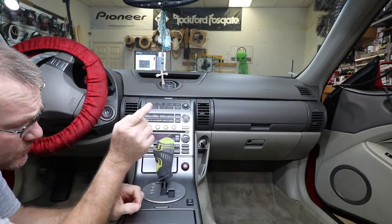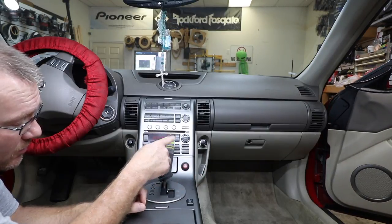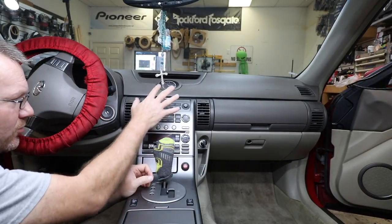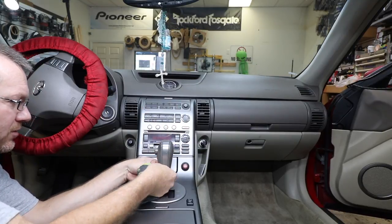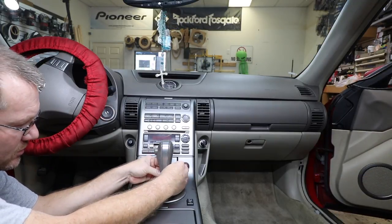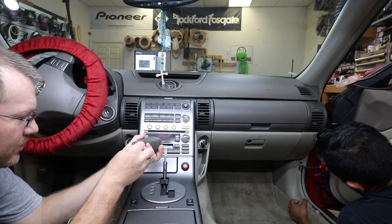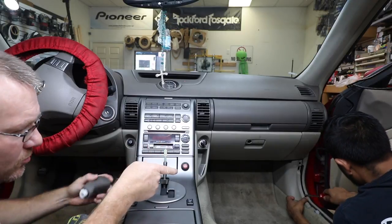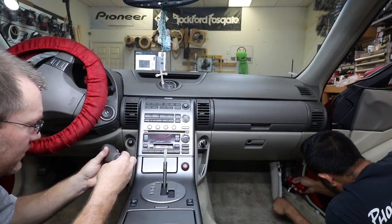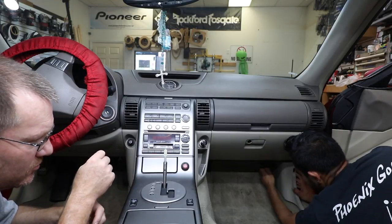To replace the radio, you actually have to start over in the passenger kick panel. You have to remove the running boards, the kick panel, the glove box, this side panel, and then drop this. There's a lot of work before you even get to the radio. You also have to remove the gear shifter — pop the little silver thing down here, and you'll notice what we like to call an oh-Jesus clip. You can use a panel tool to remove the floorboard and the kick panel. In the back is a little 10-millimeter plastic bolt you can just twist off.